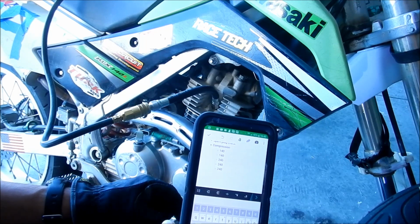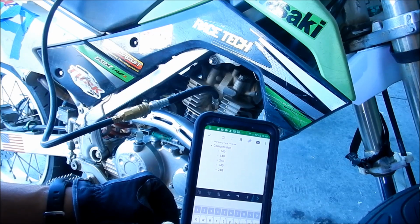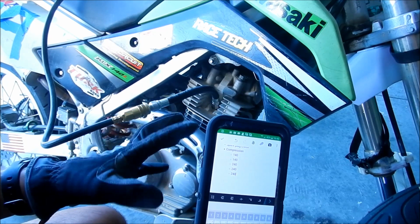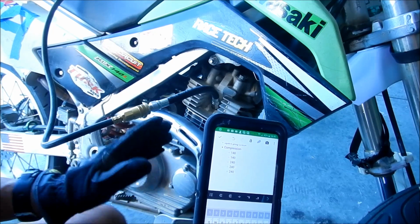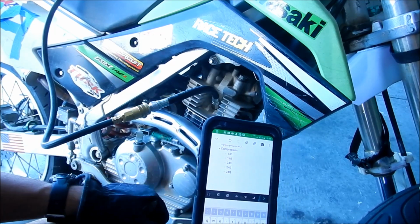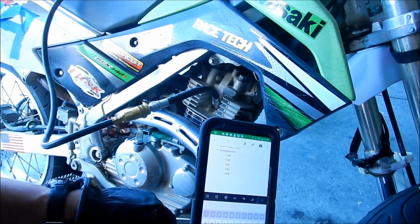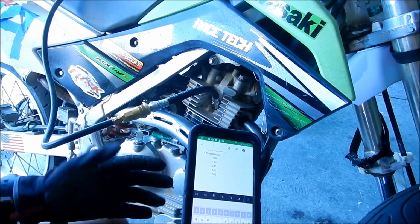It's only pushing like 20 more psi, so I don't think that's a super big jump in compression. At least I don't think it is. But if you remember, the book said 190 is the highest spec for this, and that sounds about right for a 9.5 to 1. So we've already gone like 30 psi over 190, and now we're going even higher. So I definitely think we should run a high octane fuel on this. It's a gas zipper anyway, so it's not a big deal to put more expensive fuel in it. I think a high octane fuel would be fine.